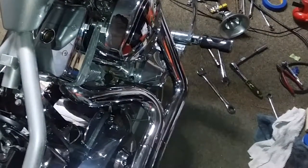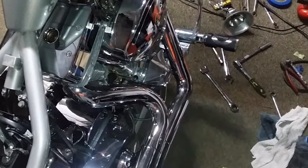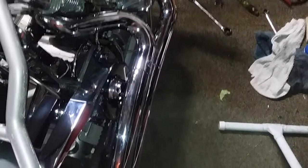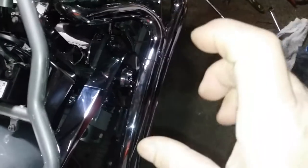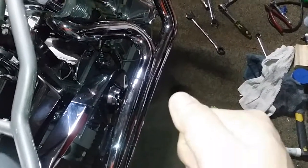And then I think what I did was — I might have tightened it a turn, I might have let it off a turn, I'm not sure. I think you have to tighten it a quarter turn after the push rod is just touching — you bring it in a quarter of a turn, which is about a half inch you move with the Allen key — and then while holding the push rod, you tighten the nut, and then you take the slack out of your clutch line.